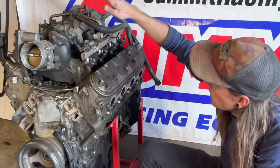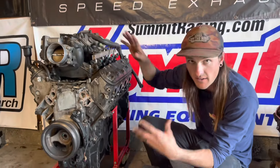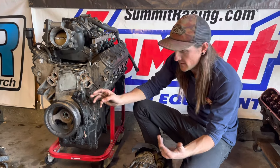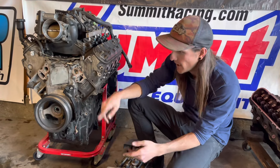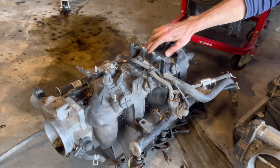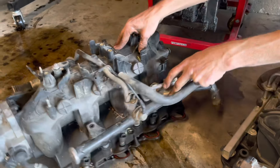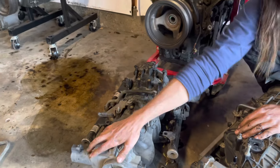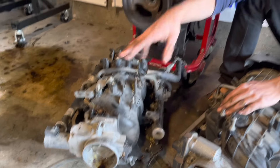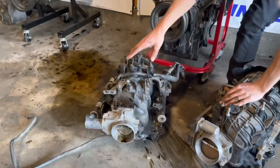Alright, I got that guy sitting on the stand — that'll stay there in the corner. Before we rack this guy up, I want to explain why this thing is very weird — a hybrid of a Gen 3 and Gen 4. The LM7 is Gen 3, 24-tooth reluctor, 1-tooth on the cam, and ran from 99 to 06. Here's an intake manifold from one of them — a really early one because it's got the return style fuel system. This one is from a Denali with a C5 Corvette style electronic throttle — 78mm throttle body, same as an LS1.